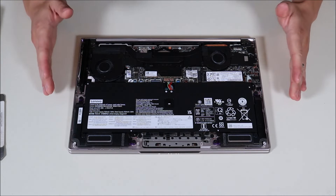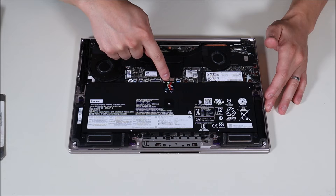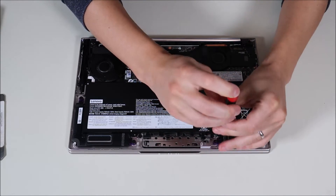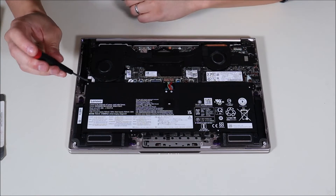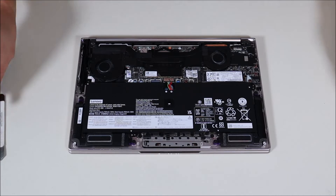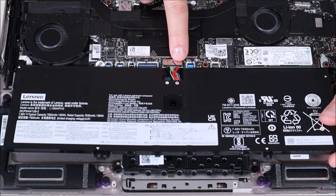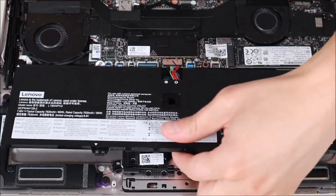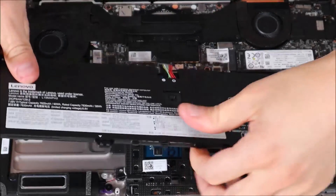Just like we turned the computer off and unplugged it, the name of the game is making sure there's no power in it. So the first thing we're going to do is take out the battery — unscrew it and unplug it from the motherboard. Keep battery screws separate from your other screws, as most components — battery, motherboard, bottom case — all have different screw sizes. As a hint, you can see white arrows or triangles on the battery that point to the screws. To unplug it, I'll use a plastic pry tool — not a metal one — and gently pull back on the battery while prying forward on the black plug. And there you go — that's how the battery comes out.